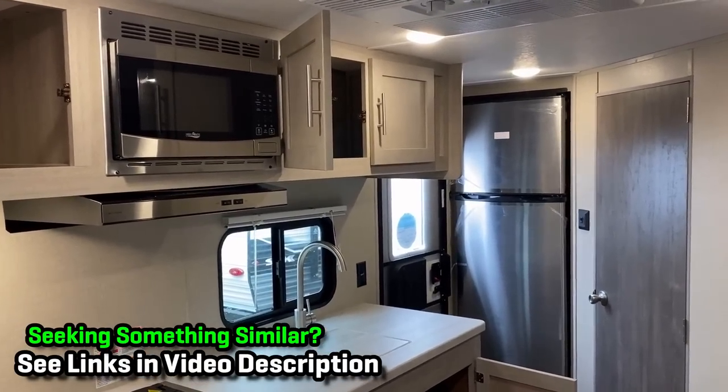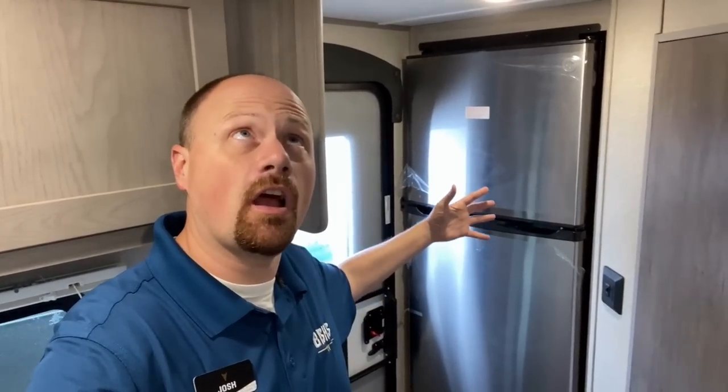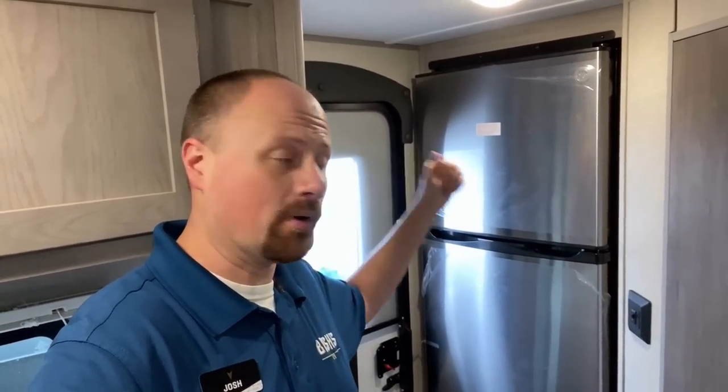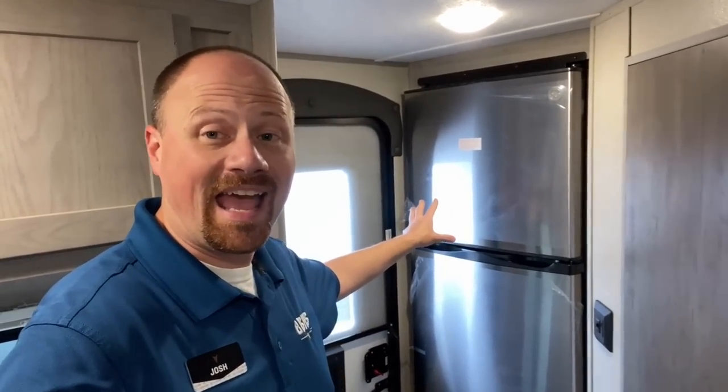I almost forgot to talk about this — something Catalina does that I love: these 12-volt refrigerators. The RV has a battery disconnect, but sometimes you want to run some lights while packing up without the fridge eating your batteries. What looks like a light switch by the entry door — those are actually located around the corner at the command panel — is actually a kill switch just for the fridge. Nobody does that. I wish more brands would do that with their 12-volt fridges. I love having the ability to decide with the flick of a switch whether I want it on or off, because not every 12-volt fridge has a kill switch. Having that extra switch is really just good forward thinking from Catalina.